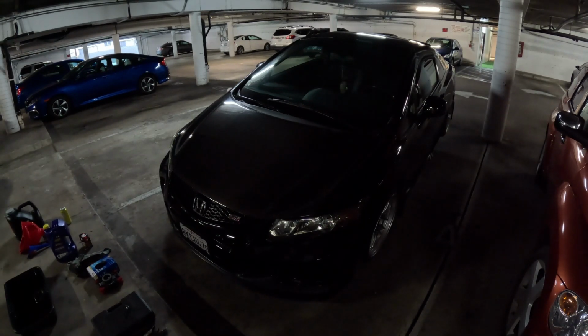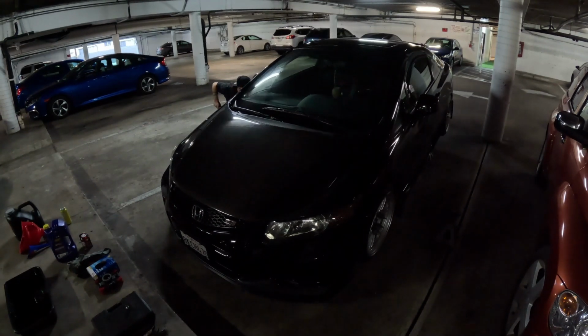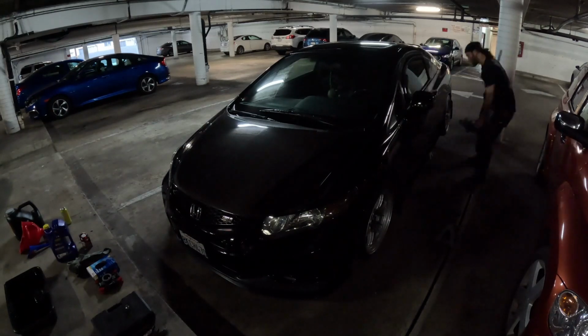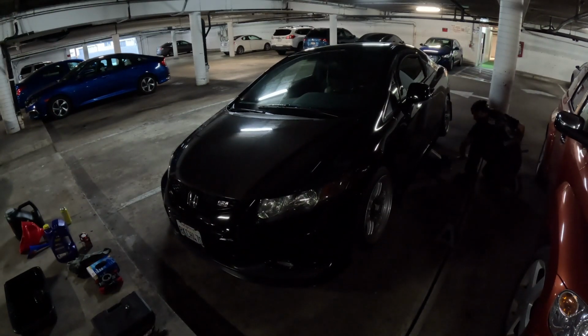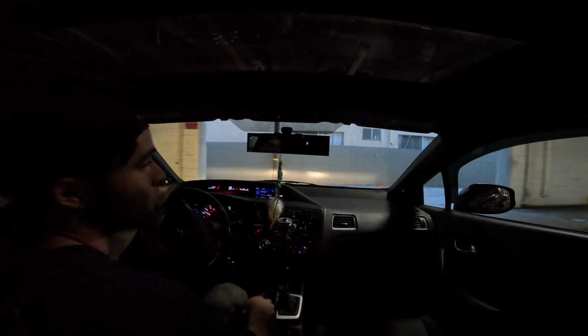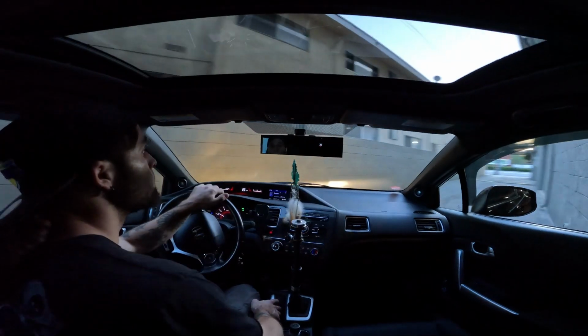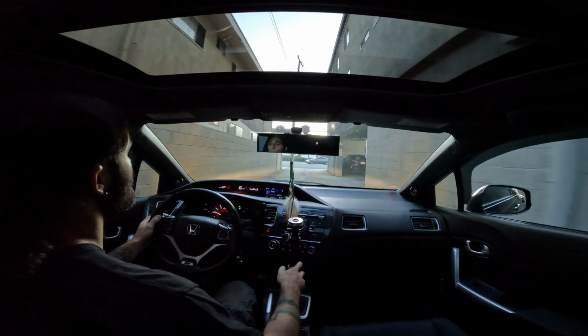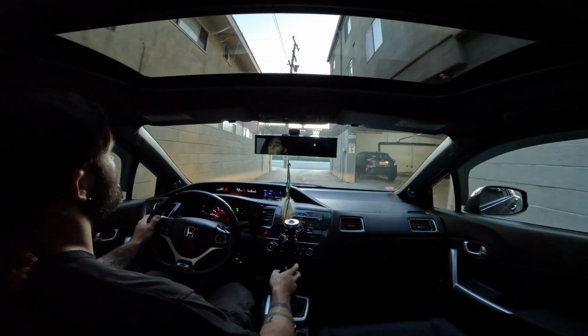And then yeah, in reverse order, basically going to take our car down. Taking it down is a little bit easier than going up with it. You still want to release the pressure on your hydraulic jack very slowly, as sometimes it's going to abruptly drop really quickly. And yeah, just make sure that the jacks have been removed from under the car by a lot so nothing gets hit, and you're going to be good to go.